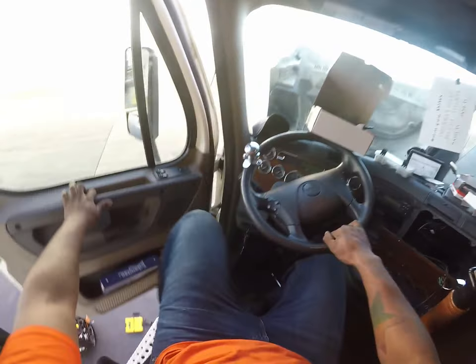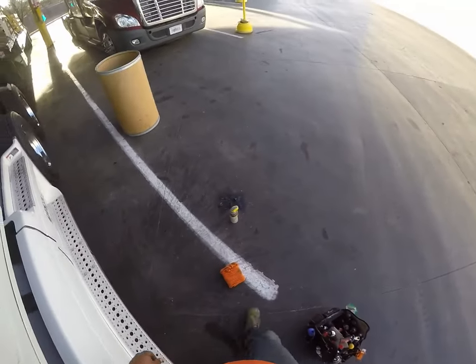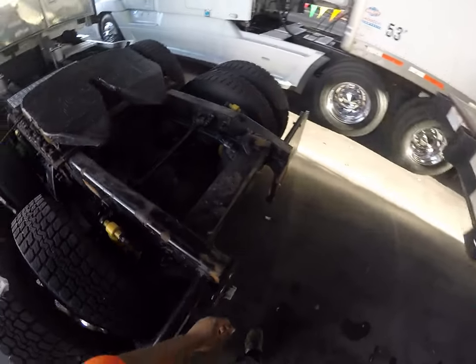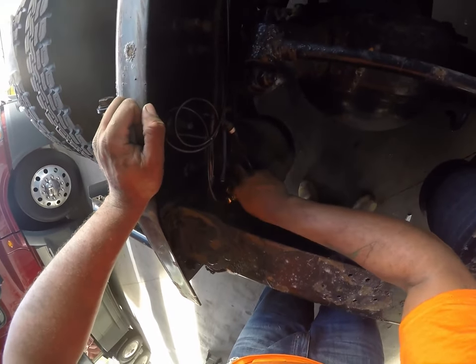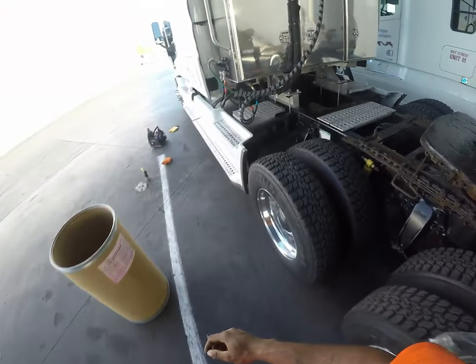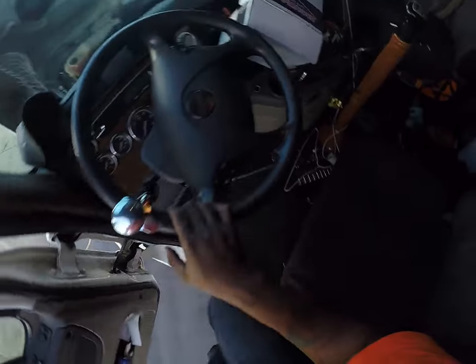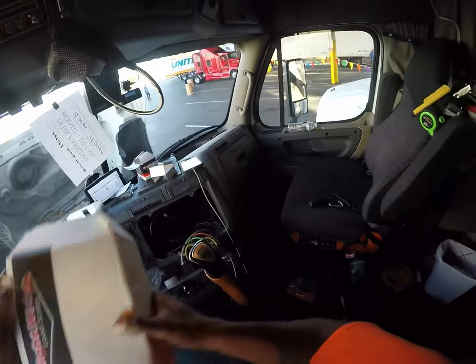I got it there. We're going to go outside the truck with the truck off, and we're not losing air. We're gonna make sure that we don't hear any air or feel any air where our connection is. We're not feeling it. All right, that's all good signs. We're gonna do one final test. I'm not gonna do the complete air leak test. I'm just gonna hold the brakes and charge the system.